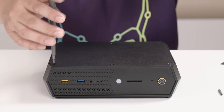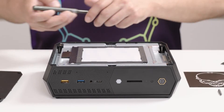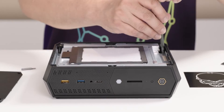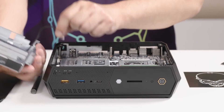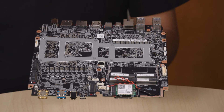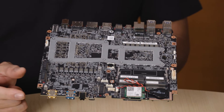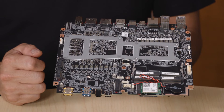It's so easy you can get it done in less than five minutes. When you get a kit, that means it does not include memory and storage, as opposed to a mini PC, which does. First, you remove the six hex screws on top — a small hex wrench is included in the package. Underneath the six screws, you have a metal shield, removed with a standard Phillips head screwdriver. From there, you have direct access to the SODIMMs and the M.2 slots — two SODIMMs for up to 64 gigs of DDR4 memory, and three M.2 slots for storage. Two are directly attached to the CPU, and one is attached to the PCH.